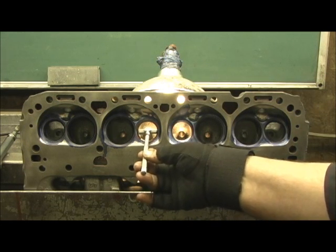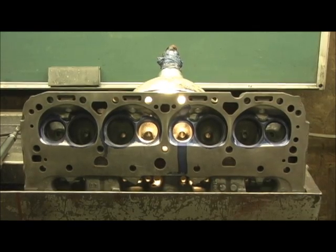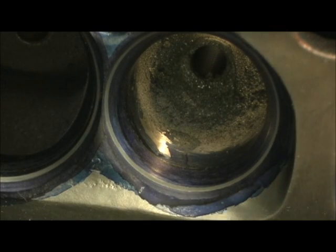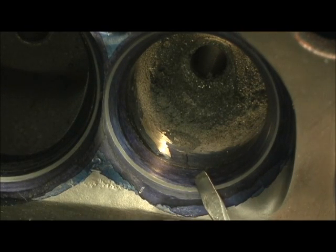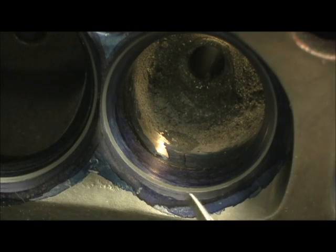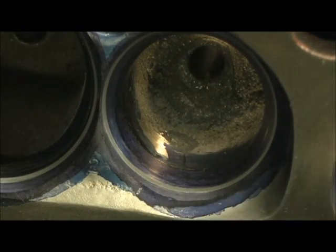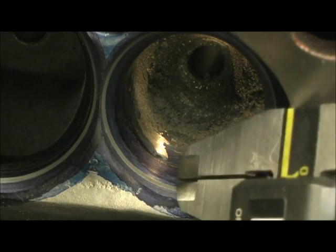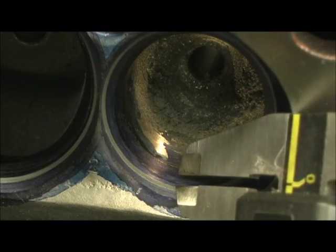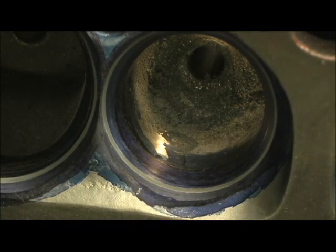Where I've done the 60, it already opened it up about 30 thousandths or so. I'm going to bring you in on a close view. I've already scribed the lines with my little scribing tool. It's really hard to see, but the line is right at the end of this tip. I can give you an exact measurement — I've already scribed all the lines on the intake and exhaust. It takes about an hour once you get the math calculated. From the edge of the 45 degree seat to the beginning of the line is 90 thousandths.